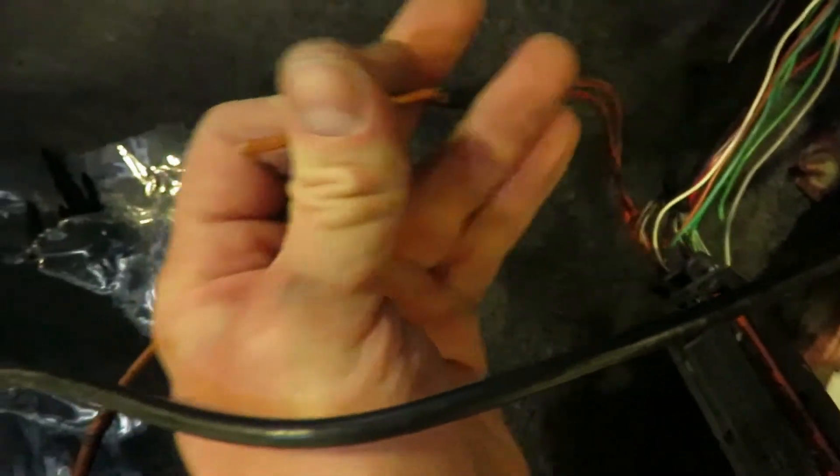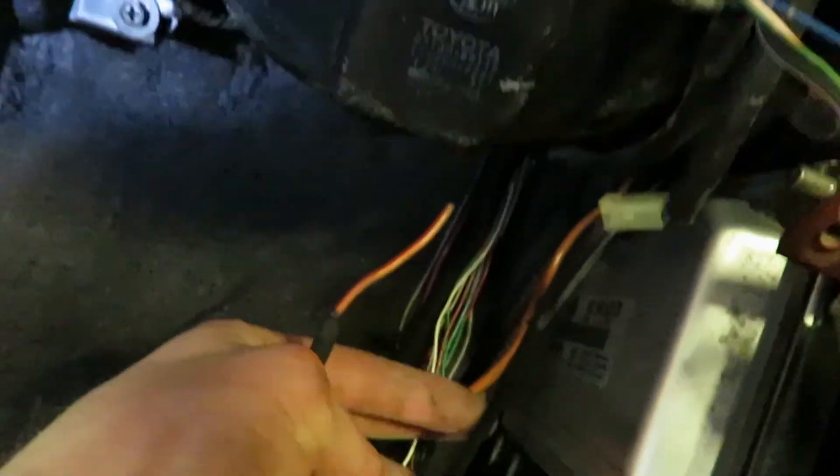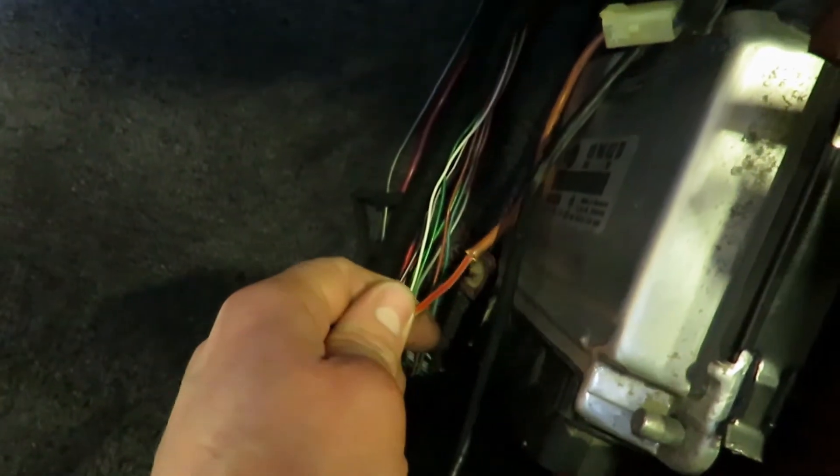That wire is run — goes up over there, all plugged in. Next I'm going to get the ECU grounded. Here is the stock ground and it splices off — it grounds two pins. I got another wire here because the original was too short, so it's got a run down to it. I'm going to solder those together and we'll have ground on the ECU.